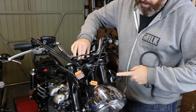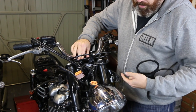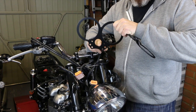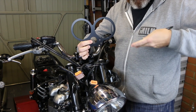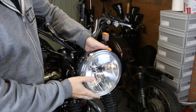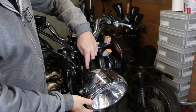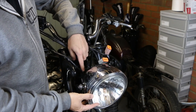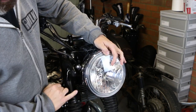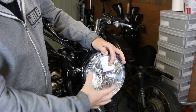The flat mount puts the clocks much lower. As you will see we've got to move this headlight down to clear the clocks. Changing the ears on the arms means that we can push this headlight down a little bit lower, and this also has a space for the ignition to go into. Now as most of the electronic gizmos are mounted inside the headlamp, to make this easier I'm going to take the front of the headlamp off to access all of the plugs and everything stored in the back — it is just the screws on the side, one either side.